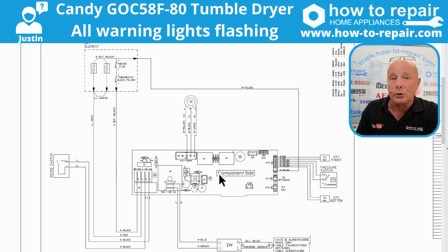There's a relay on the circuit board which will be the higher amperage relay. I haven't got a picture of this specific circuit board, but you'll be able to follow the wiring on the circuit board to the correct relay. You normally have one, two, or three relays on the circuit board performing different functions — one of the relays is there to turn the heater on and off at the required temperature. I'll put all the links to this wiring diagram and other videos in the description below to assist you, but at least you've now got the wiring diagram for your machine. Thanks very much, I hope this helped you.